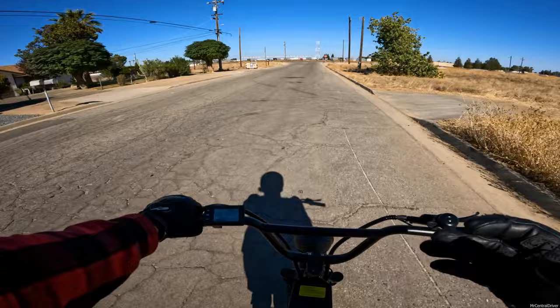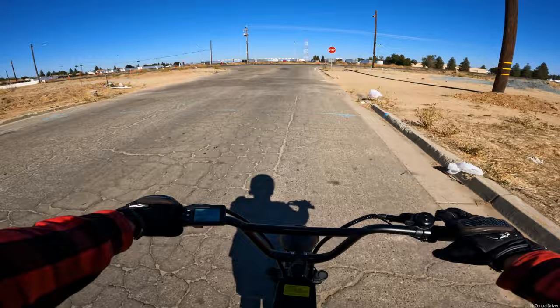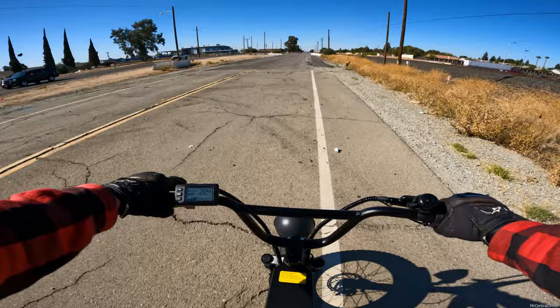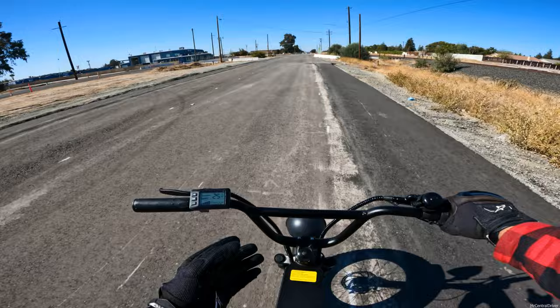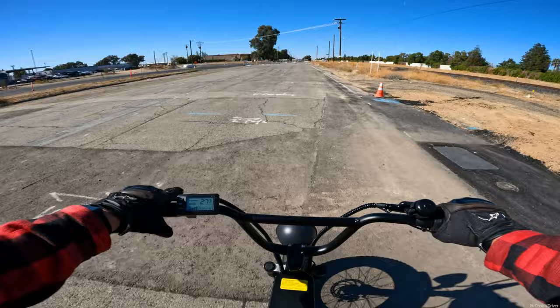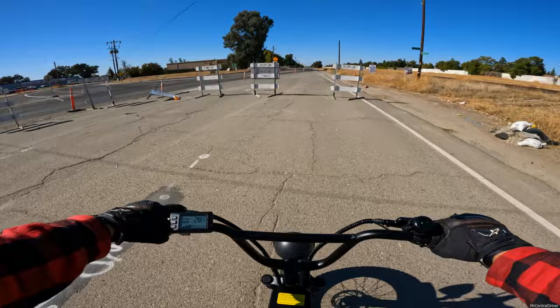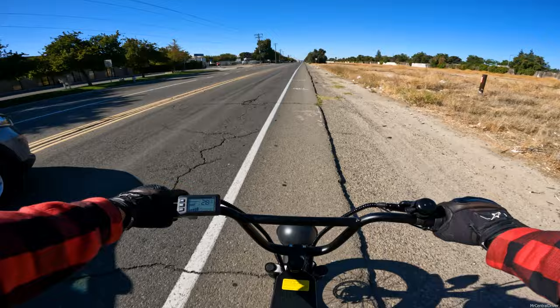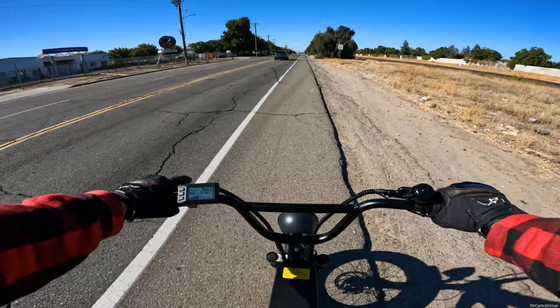Since I've had about 20 miles on this bike, here's my overall feel. First thing: we lost one of the headlight bolts. There are supposed to be two bolts on both sides of the headlight bracket, and one is already gone - sometime in the first 20 miles. So now the headlight is really bouncing all over the place. If you have this bike, double-check your headlight bolts or use Loctite - take the bolts out, put Loctite on, screw them back in.